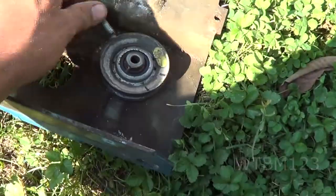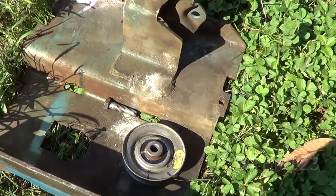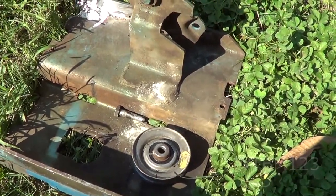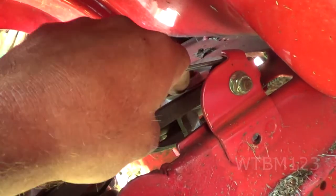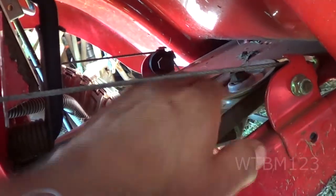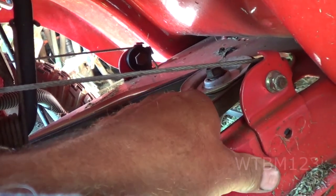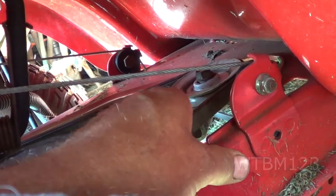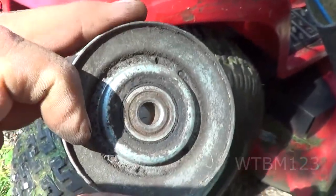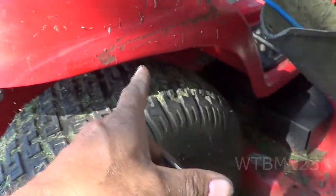That pulley is unavailable from Sears, but the flat idler pulley that you adjust is back in the frame — you can still get it at Sears for $15 plus shipping. This is my MTD motor. You look at this belt, the drive pulley right here — you're not going to see it — but that pulley and this pulley are almost identical, both have a three-eighths insert. This one here is pretty much flush at the top, so I think it would work. That pulley would be sitting in there like that; it has that shoulder which you really don't need, but if you turn it out and just put a longer bolt in it...